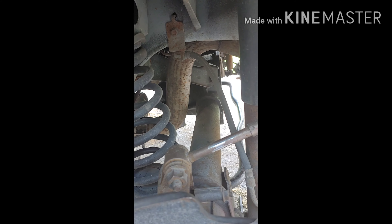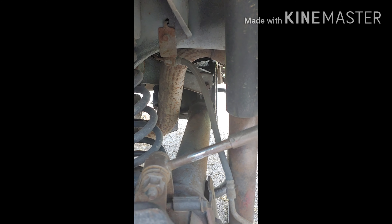One thing you can do is use a 13 millimeter bolt to take your sway bar out of the way — it makes it easier to get to the rear end. What you've got to do is knock the races out. You need a long punch like that. There are two spots on the back and the front, and you'll see little notches when you look in there. You knock the race out for the inside bearing and the outside bearing. I'll crawl under here and show you — there's the bearing.